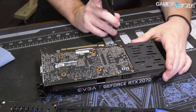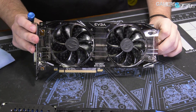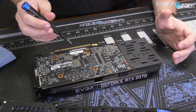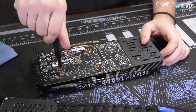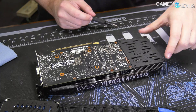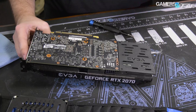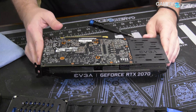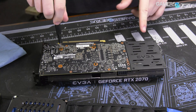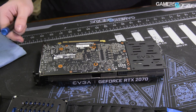There's really not a lot of room for manufacturers to price out a cooler because they're spending so much on the GPU itself, and then they're trying to keep a $500 price point. So for the back plate — you end up with something that's only really there aesthetically. It doesn't need to be there at all; you just blow air straight through it. It's not really a back plate — it's just a back-of-heatsink that hangs over the PCB. And the PCB, as you've likely noticed by now, is short, which places the power pinout right in the middle there, like we've seen on Vega cards and others.